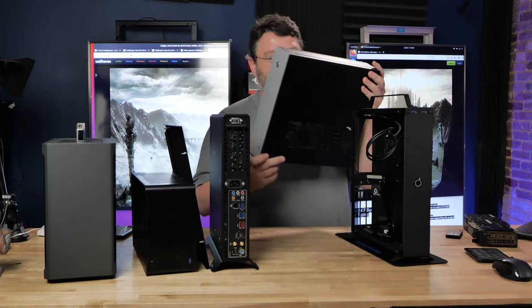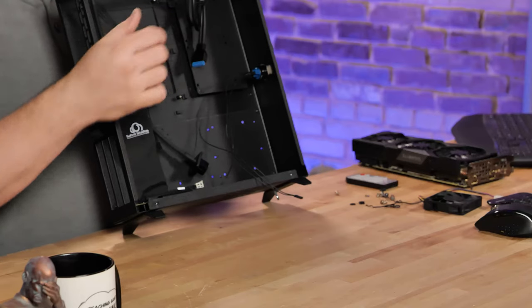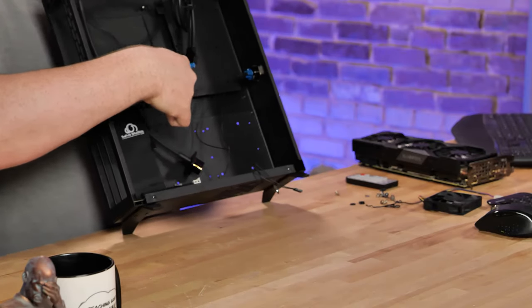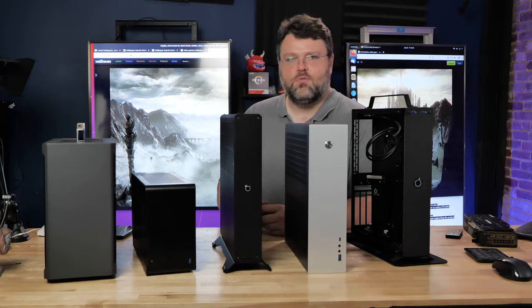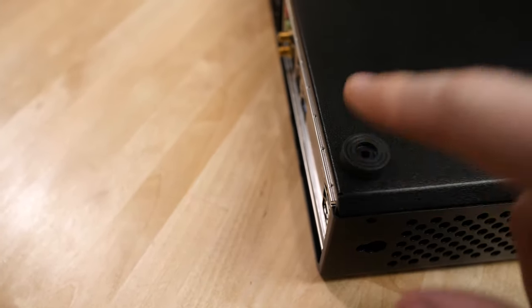If your motherboard has an M.2 slot on the rear, getting to it on the Consola isn't easy — there is a vent so the back is ventilated, but accessing that M.2 is not straightforward. Whereas on the Salvo Studios S402, you just pop out four Phillips screws and you can replace your M.2 without tearing the whole system down. For horizontal configuration, Dr. Zaber wins hands down — it comes with much better feet that are molded for holes on the back of the case, not just stick-on feet.